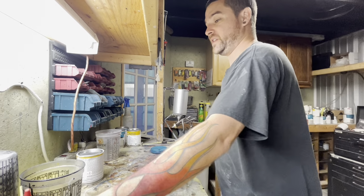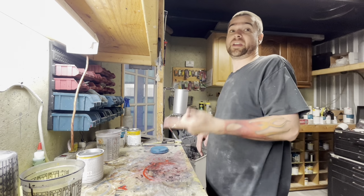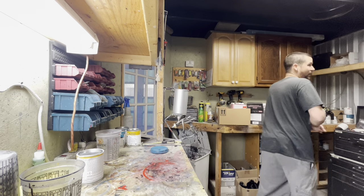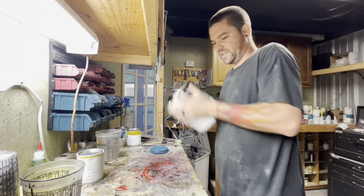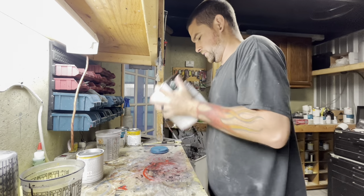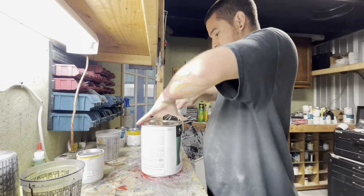Straightening up my stuff. It's been a train wreck for a minute. All right, so let's see here. First thing we're gonna paint is Randy's back bumper and the gas door. That's got to go first. So let's find his paint. Here's the back seal. So we're gonna lay down a sealer. We're gonna lay down a VAP seal over the bumper and the gas door.